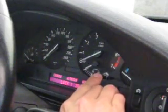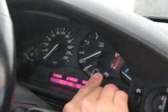Using the left control button, scroll through the lock until you get to the number matching the sum of the last five digits of your VIN. In this case we're going to use 38. Once you've entered 38, press the right control button and it will now have an unlocked cluster, and you can go through all the different options that are available to you.